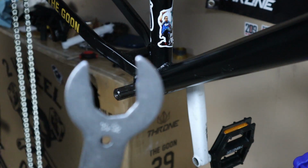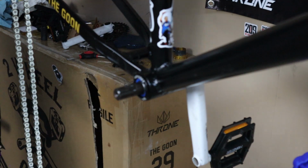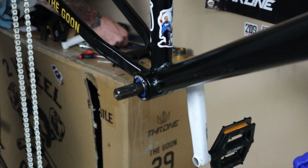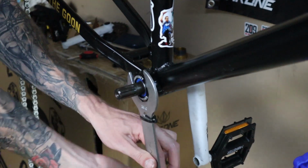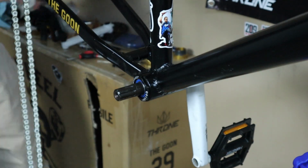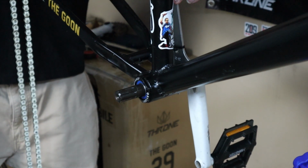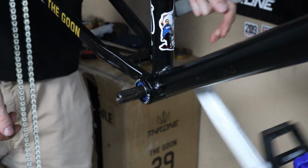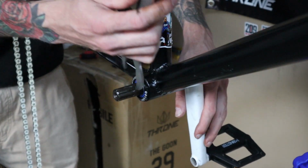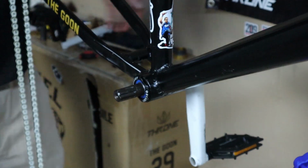Okay, and just so you guys are aware, it does take a different bottom bracket tool for this ODYSSEY bottom bracket versus the one that came off of it. Use this one. I'll have links in the description below for both tools. So, continuing on with tightening her down towards the tail end of the bike. Just got to be pretty snug. You don't want to overdo it. Your cranks might get stiff, have more drag. So ultimately, as you can see, it's freely spinning. Sounds good. There we go. All right.